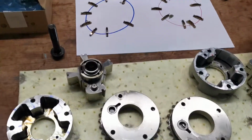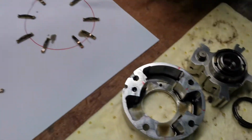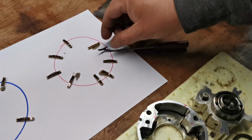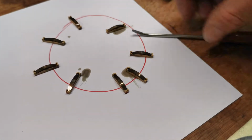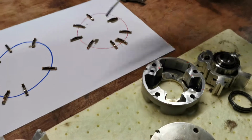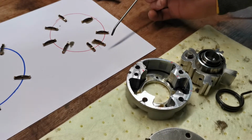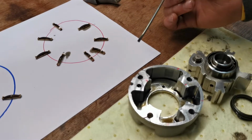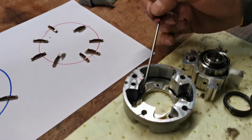Another thing worth mentioning, guys, when you are pulling these apart, take a photograph of the orientation of the casing, and then you have the wiper rings here. I've just pulled that off by mistake because my screwdriver appears to have a bit of magnetism to it. But you don't want to interchange these from any other side. This one goes here, that one there goes there. These will wear to a degree in their own respective chambers. It's also worth mentioning, when you do remove them, put a mark across them so you know which end of the brass wiper ring is facing top, because as these wear, they'll wear to a bit of a taper, I would imagine. You want to make sure that taper is reintroduced here.